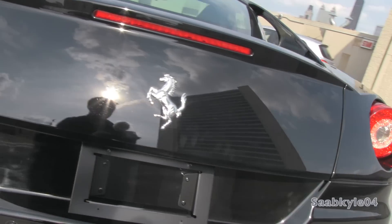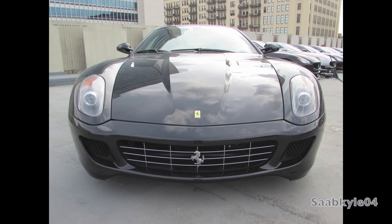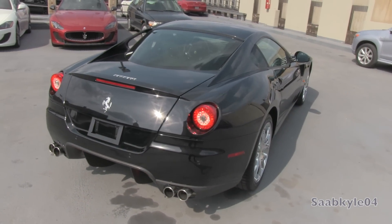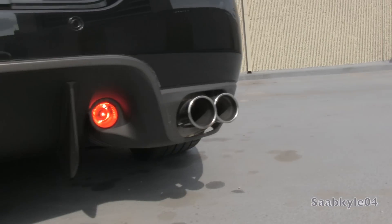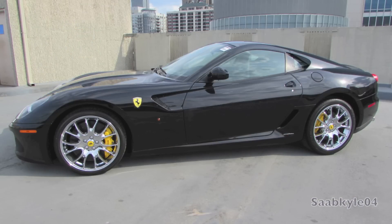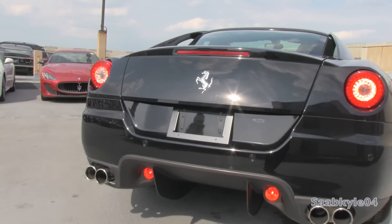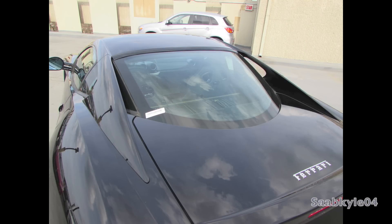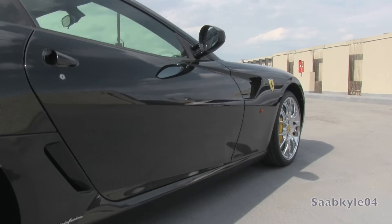The Pininfarina-designed aluminum body is a beautiful blend of muscular bulges and sensuous curves, designed from the outset to be the most aerodynamic front-engine 12-cylinder the company had ever produced. Up front, the bi-xenon headlamps are pushed towards the edges with a wide profile, and the power dome hood hints at the massive V12 underneath. Gaping vents in the lower front fascia feed air to the engine and cool the optional carbon-ceramic Brembo braking system. The hood also has matching vents on either side of the power dome functioning as heat extractors, fender vents evacuate air across the sides, and lower flank vents provide extra air to the fuel tank and gearbox cooling. In the back, the flying buttresses help channel air over the upswept deck lid, reducing lift by 110 pounds without adding drag, with an already low drag coefficient of just 0.34.